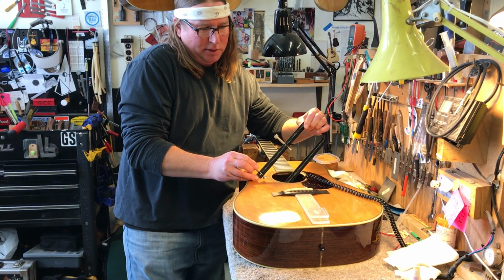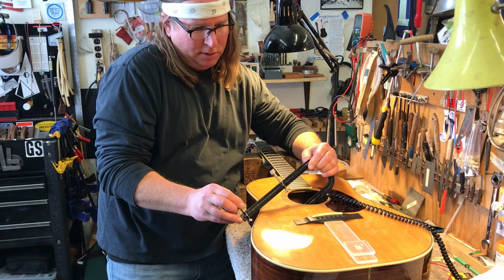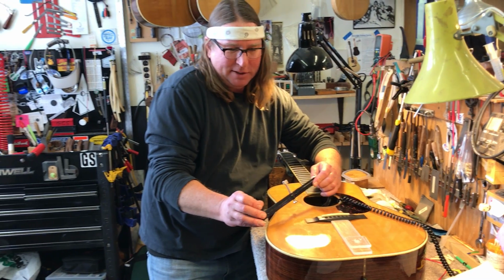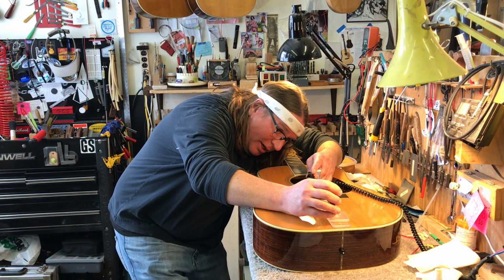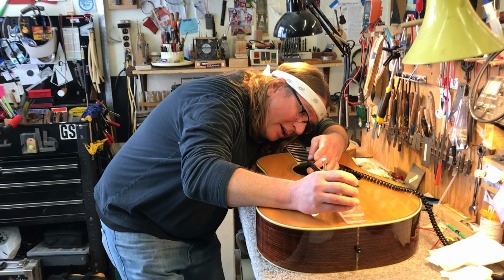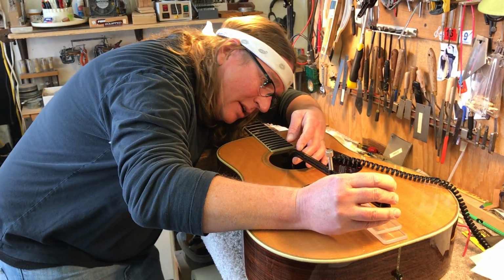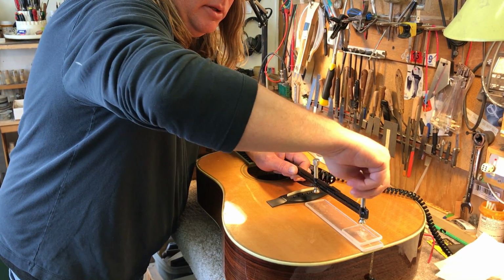And it's a little tricky to put in. Got to go sideways first. I've done this so many times. I call this cold and crack season in Colorado because I do one of these almost every day. Now what I'll do is I'm looking inside and lining this cleat up right on that crack. And once I get it lined up, which is there, I'll tighten this down.